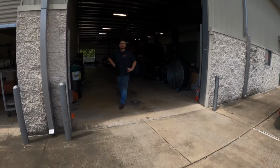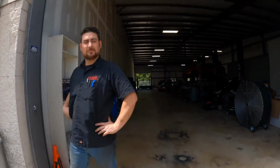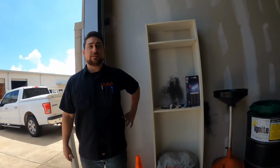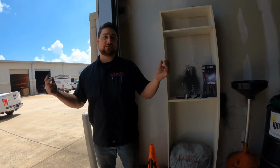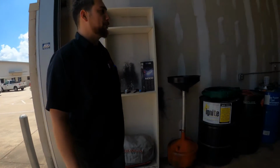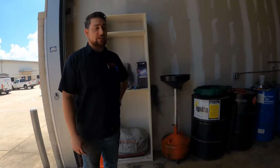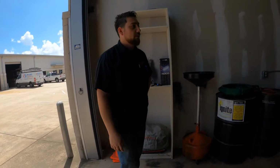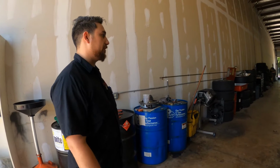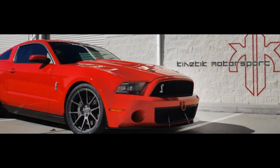Did you guys take off the ABS lines in the back for the dyno so it won't stop it or what? Yeah, so it doesn't try to pulse the brakes. Oh, I see. The fronts aren't spinning and only the rear, so the computer's going to start tripping out. Oh, so it'll start pulsing the rear brakes. ABS will start coming on. Ah, so you guys just unplug them and then plug them back in after the whole deal. And so that's why he makes a lap real quick. Oh, to make sure. Reset the ABS module. Ah, I see. Nice. Okay. Rather than get in and something's not functioning right. Okay, nice.